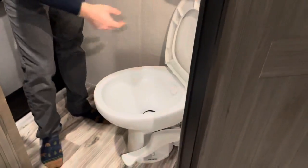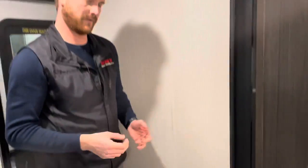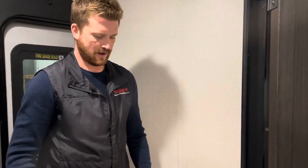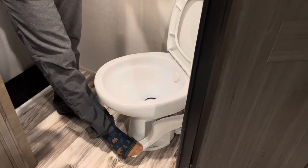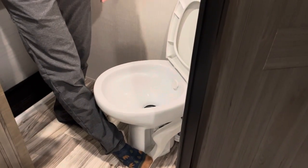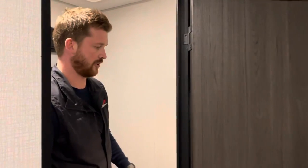You've also got the toilet in here. Anytime you're using the sewer system in your RV, make sure you use a good potent RV toilet chemical — available in powder, liquid, or tablet form. When you add chemical, pour it right into the bowl, push halfway down on the foot flush to fill the bowl with water, then push the rest of the way down to flush everything into the tank. That toilet chemical needs a little bit of water to activate it, so always put water down with the chemical. You'll want to put new chemical in the toilet immediately after every time you dump your holding tanks, because you'll have dumped the existing chemical out.